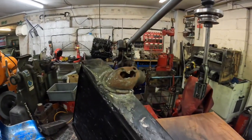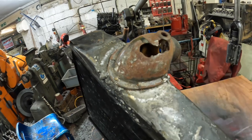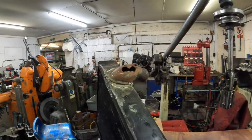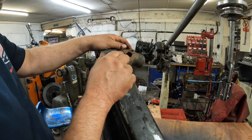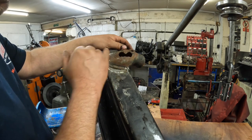A job I did a little while ago on a few videos back was fixing a Ford Model T cylinder head which was cracked. The customer's been back today with a radiator from it. Basically he's broken this part of the cast iron out — this is a 1930s item. With it being cast iron I need to try and work a way of repairing that. What I'm going to try and do is get some cast iron from something else and then basically try and weld this half up first, then the other half, with cast iron rods. My first job is just to neaten up all of this to make it easier to make something out of.